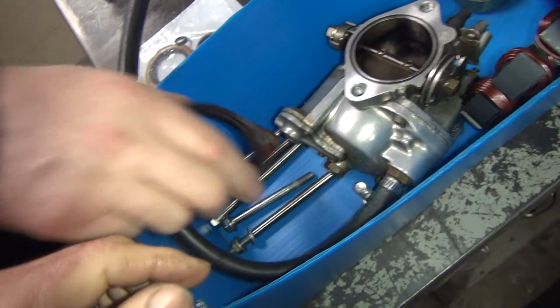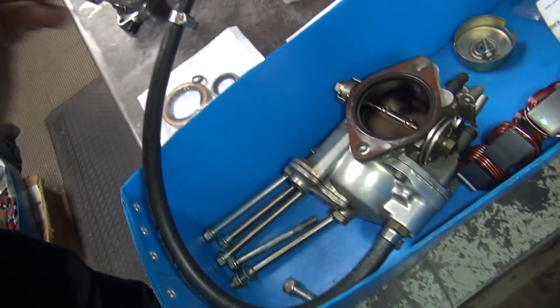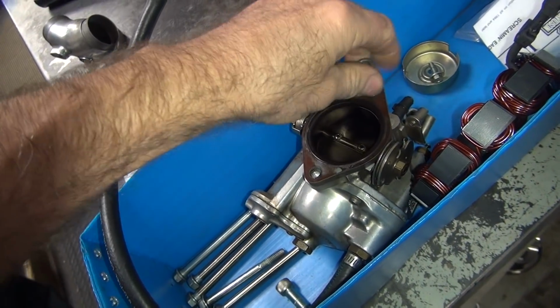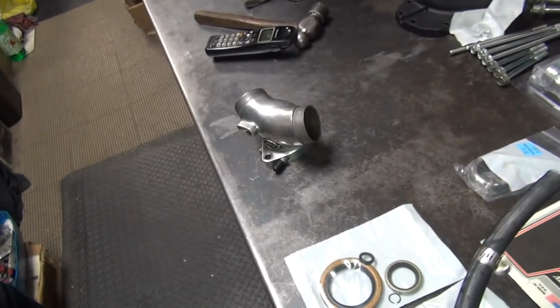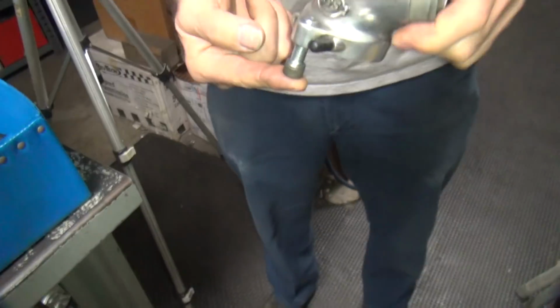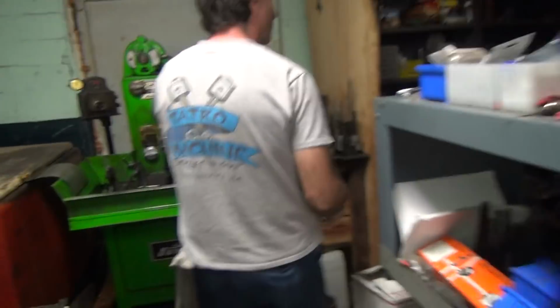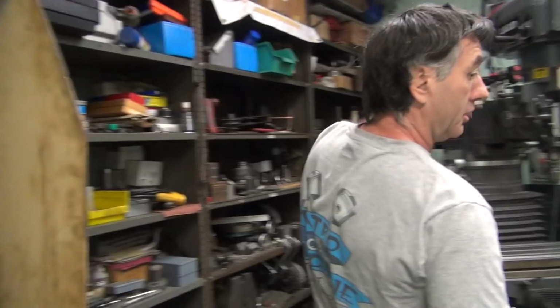Check fitment. So where's the 2 bolts that went on this? Oh, I didn't do the... Didn't fix the manifold. Why didn't you fix the manifold while you're over there? Yeah. Remember that? See how that doesn't go through? See, it's loose on this side and not on that other side. Oh yeah. Somebody over torqued it. Who would do that?